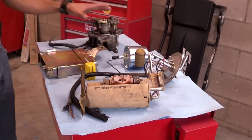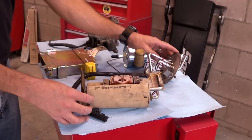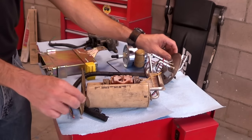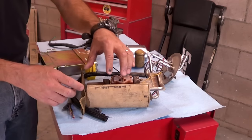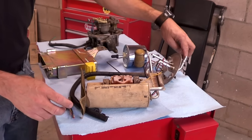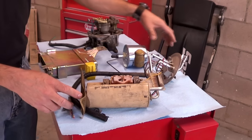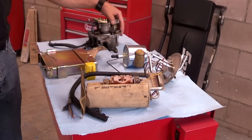For the fuel delivery it's similar to the multi-port fuel injection. A fuel pump module is going to have a fuel pump strainer that filters the impurities from the tank. As the pump is energized, the fuel travels through the supply line, exits the fuel pump module, enters the filter, and it travels to the throttle body unit.